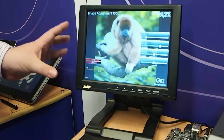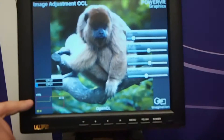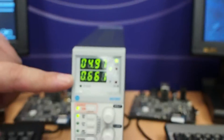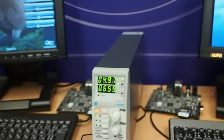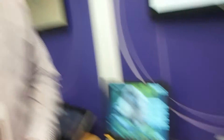Now let's see what happens when we take this away from the CPU and put it onto the GPU using OpenCL. We've got 42 frames per second performance now, and the power is actually back down below where we originally started — just 0.65, 0.66. So that was around a watt less than using both cores, and even less than using one CPU core. For much better performance, and this applies to many different applications — if it's something highly parallel, take it away from the CPU, put it onto the GPU. You can do that right now.